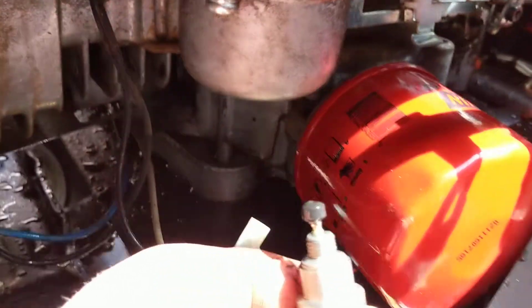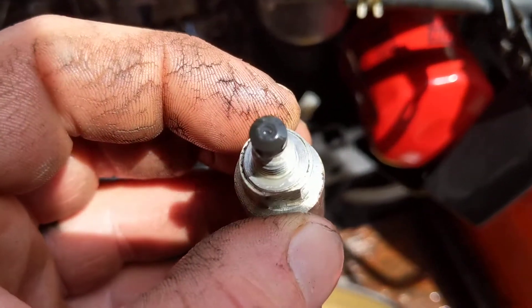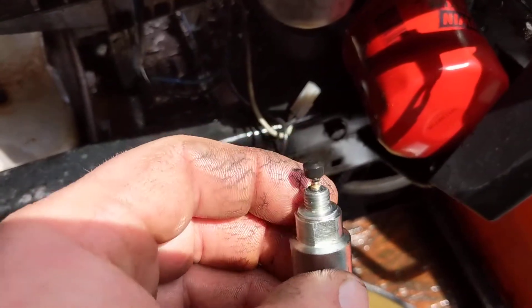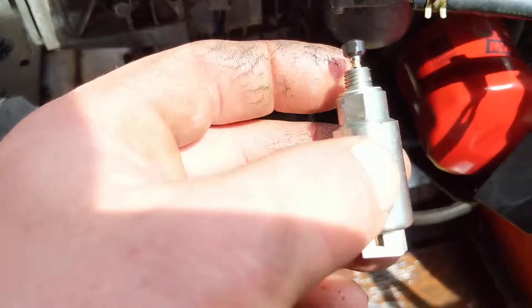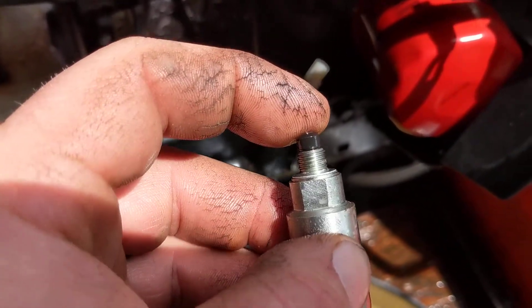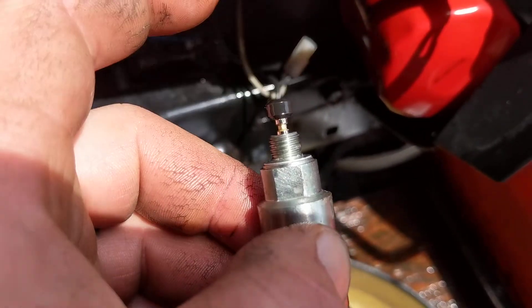And there you can see the tip — that's the little rubber plunger tip I was talking about, and right now it's in the up position, so it's plugging the bottom of the pickup tube in that carburetor. So when you apply power to this, it actually pulls down and allows flow through the pickup tube, and when you release power, it plugs.